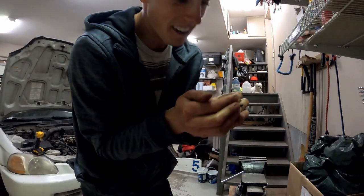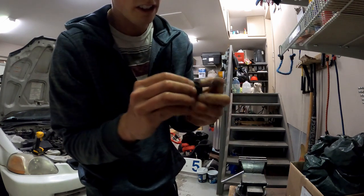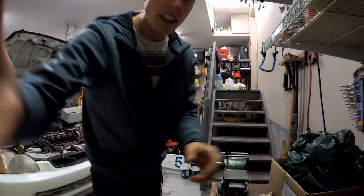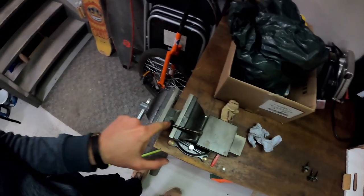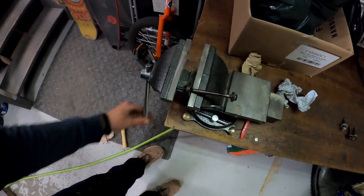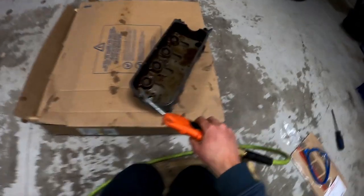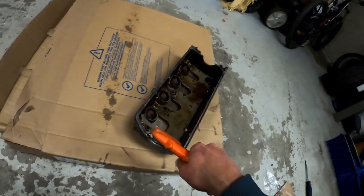Here's the new one going on - we'll see if it slides on, it might need a little lubrication. There we go. I forgot one step: before those other two steps to get the washer off, tighten it in the vice this way and start pinching it - that'll pinch half off, then do the other two steps. The air compressor is hooked up and the next step is just to blow out some of the crud from the gap where the valve cover seal goes.